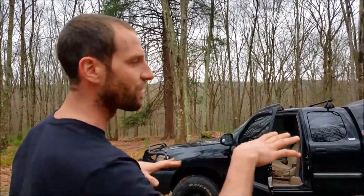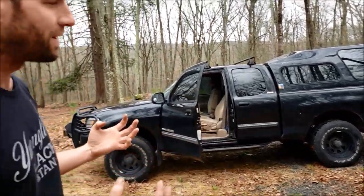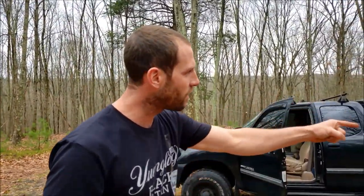So you can do that with a weak battery. Of course if the battery was completely dead it might not work as well — you might need more of a hill because the alternator would have to start turning to get the 12 volts for the ignition. Also keep in mind you need a hill. If you were parked the other way you could do it in reverse gear, and if you have gravel or sand you'd want to leave it in four wheel drive, because those wheels need enough traction to spin the motor over.